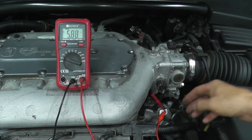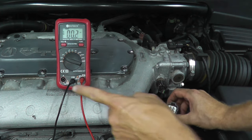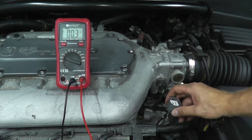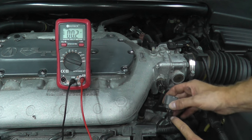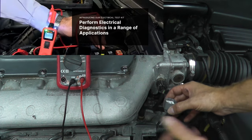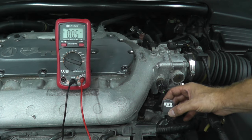If you're doing this on your vehicle and you test every single lead, first make sure you have a good ground — if you don't have a good ground, you won't have a reading. Secondly, if you've triple-checked everything and you're not getting a reading, then you have a wiring issue and you'll have to track that down with a power probe or some other device. But chances are you should not have an issue here.